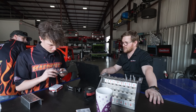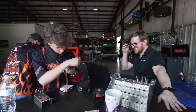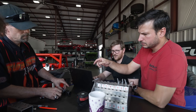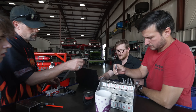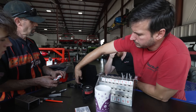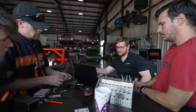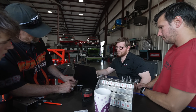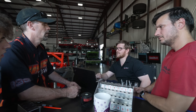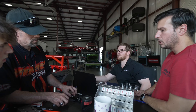She can take more if I knew what I would actually do. We're barely starting to lose differential pressure a little bit. It means we're not going to be able to turn the boost up much more. Is it the turbo maxing out? No — fuel pressure. The pump is small, it doesn't fall too much, but we're starting to lose fuel pressure. You want to pump it up? No, because it's going to make it worse — we need more volume. The pump doesn't like high pressure.